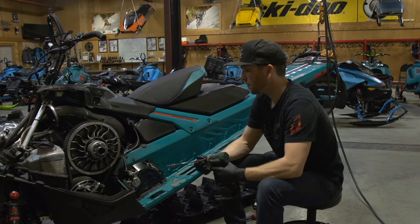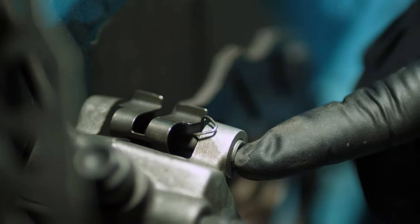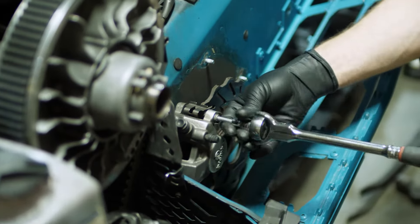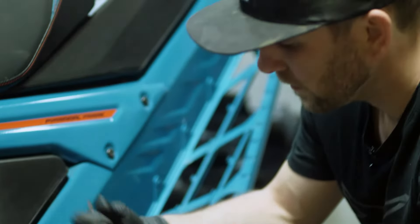To remove the cover on the brakes it's three 10 millimeter bolts and a Torx 30 down here. It's important to do the brake side first before the chain case, as we'll have to pry on this a little bit to get it out. If you do the chain case side first, it'll want to pull the whole drivers out — so it's very important to do the brake side first. Now that the guard's off, you can see there's a small clip here holding the brake pad pin in. Just remove it with your screwdriver — be sure not to lose it. Next, your five millimeter Allen pulls out like that, and you can see the slot where the pin needs to go. Simply pull the brake pads out — these ones are basically shot, so we'll probably put some new ones in when we go to put it back together.